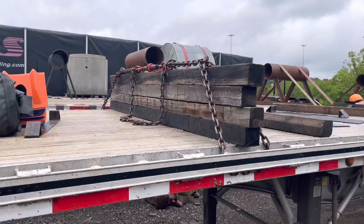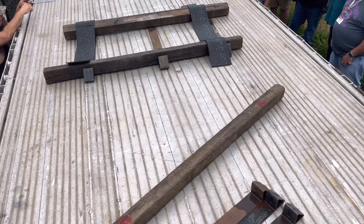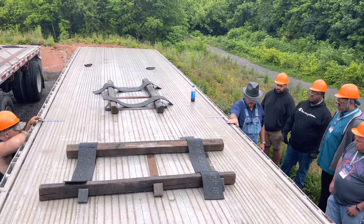I'm going to move from the prop here so everybody can see. On the 53-footers, most of the Mack trailers have it — it says 'place coil here.' So you don't go by the center light on the 53-footer. But a 45, center light is the center of the trailer.